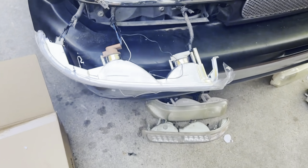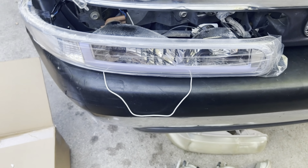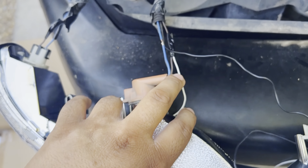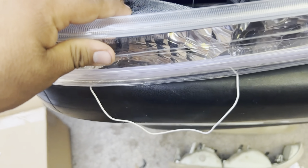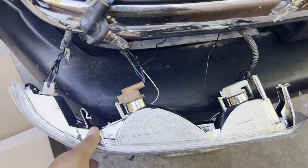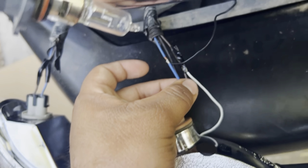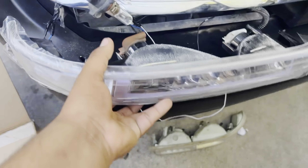We already got one connected. I went from the stock ones to the LED strip headlights. You're gonna be connecting the blue to the black and the white to the brown so your LED strip will come on. I'll show you in a sec — let me go ahead and get both pairs on the bottom done. The brown goes with the white and the black goes with the blue — just patch those up and the LED should come on.